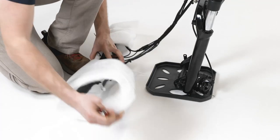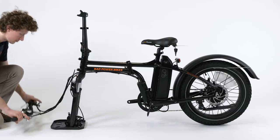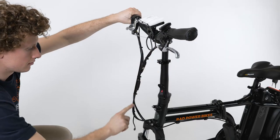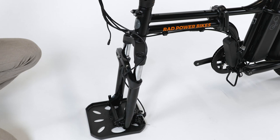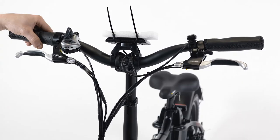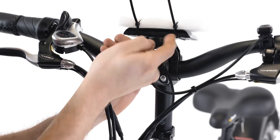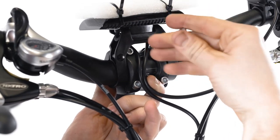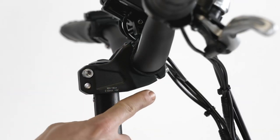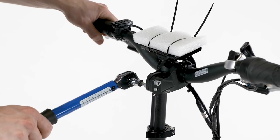Remove the packaging from the sides of the handlebar and snip the zip tie securing the stem faceplate to the handlebar — it's held in place by the display. Orient the handlebars so the brake levers face forward and the three-button remote is on the rider's left side. Trace the brake cable from the left handlebar grip to the brake caliper on the left fork lower and make sure the bundle of cables is not twisted. Place the handlebar on the stem so it's oriented properly and centered. Install the four bolts and use a 5mm allen wrench to tighten part way in an X pattern. Ensure the gap between the faceplate and the stem is evenly spaced and the bolts are tightened evenly. Torque the bolts to 10 newton meters. Torque the upper and lower handlebar stem clamp bolts to 15 newton meters.